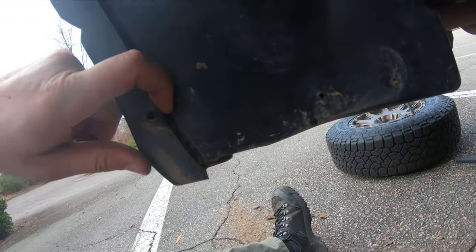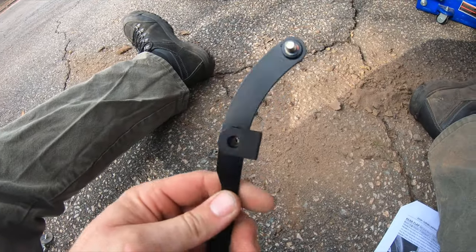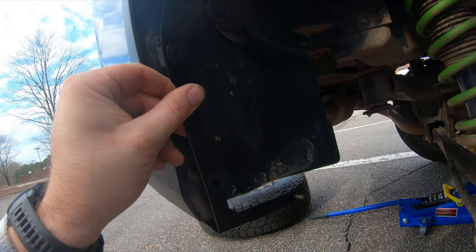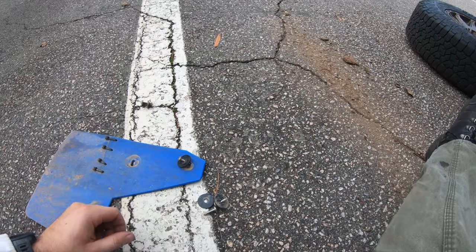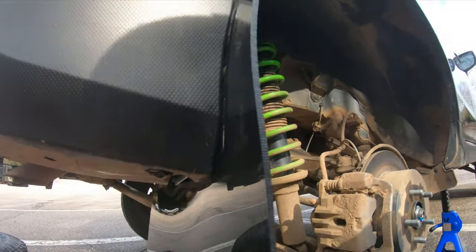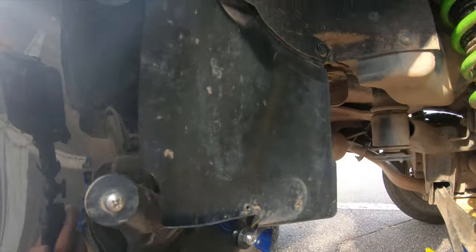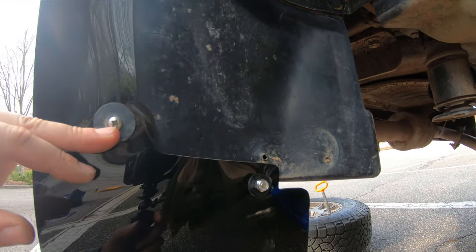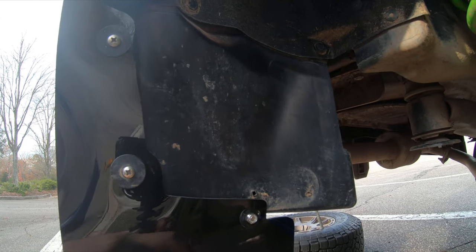There's a shitload of dirt in there. Anyway, using these holes right here — these are the inserts that actually came with Rock Blocks, and these inserts are the absolute same that came with Rally Armor. These are going to slide up on there like that. I'll reuse a body clip — the factory body clip goes right here. So here it is installed: two backers that the screws go into, and the plate is hidden back between the trim pieces. There are studs on this backing plate and two holes — so two Phillips screws, two studs with two nuts, and plastic washers.